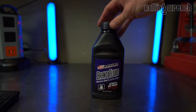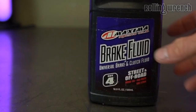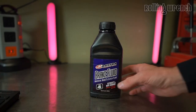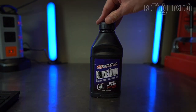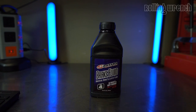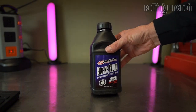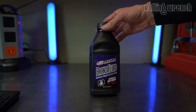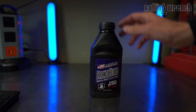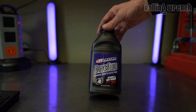Let's talk about brake fluid. This is DOT 4 — kind of an upgrade from DOT 3. DOT 3 is old school; it eats paint super easy, and so does DOT 4, but not quite as easy — it just has a higher boiling point. They even have DOT 5.1 for heavy duty trucks and applications, and then the silicone-based DOT 5 you see in Harley Davidsons. You won't use those in a motorcycle, scooter, or ATV — you're always gonna use DOT 3 or DOT 4 in general.